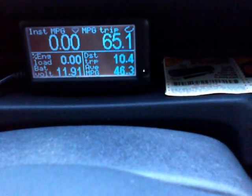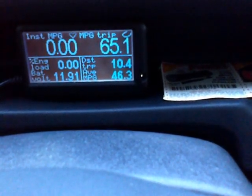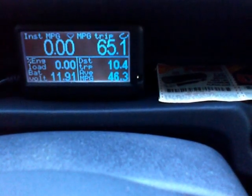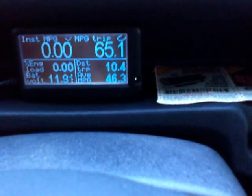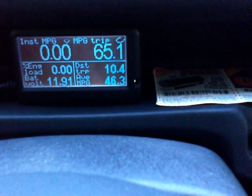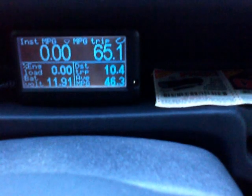The lower center left shows the percent of engine load. I use that to monitor how fast to go on the pulses, or how hard to push the throttle on the pulses. I want to keep the engine load at about 80 to 83. When I'm doing the pulse it varies a lot — sometimes it's down to 65, sometimes it's 78. I'm going to try and keep it under 80 and above 75 when I'm pulsing.